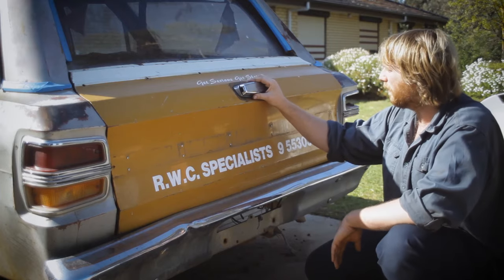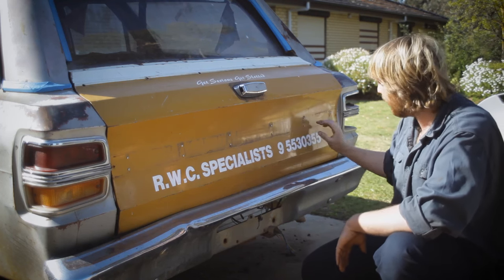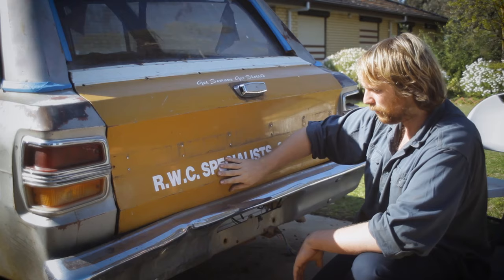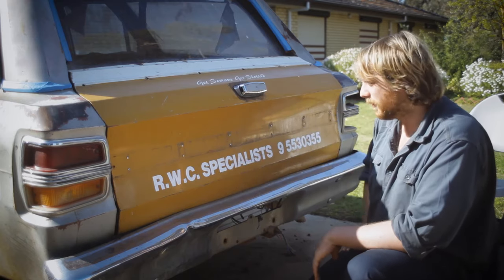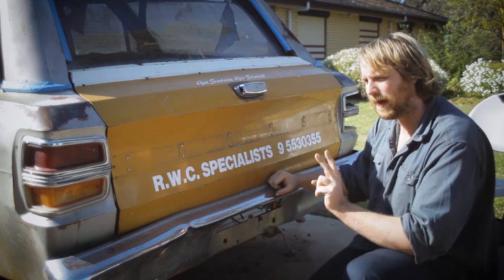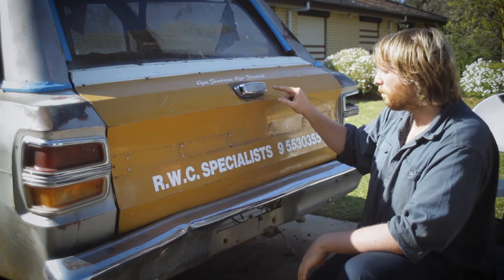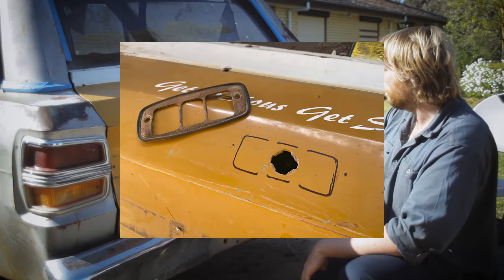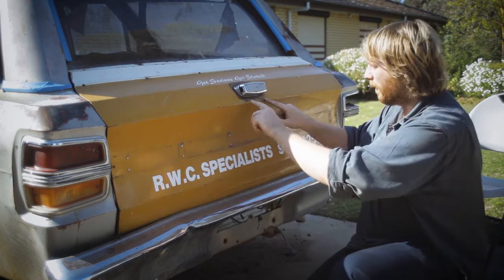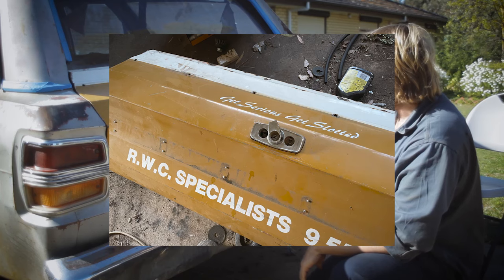I also assembled the tailgate on this Falcon. It came with a rust-free tailgate skin - it has been repaired and there is a patch line through here that you can see at the back of the tailgate, and lots of bog to make the shape, but it's pretty well done so I'll leave it. It isn't rusty which is really good. Both tailgate parts needed to be bought - both were rusted out, picked up for about $80 a piece. They were both manual tailgates, not electric, so I had to cut a hole here for the manual regulator, then measuring off the crease lines to square up the two mounting holes.